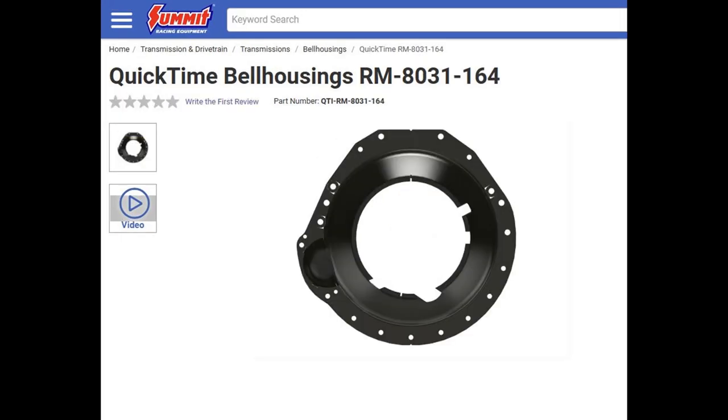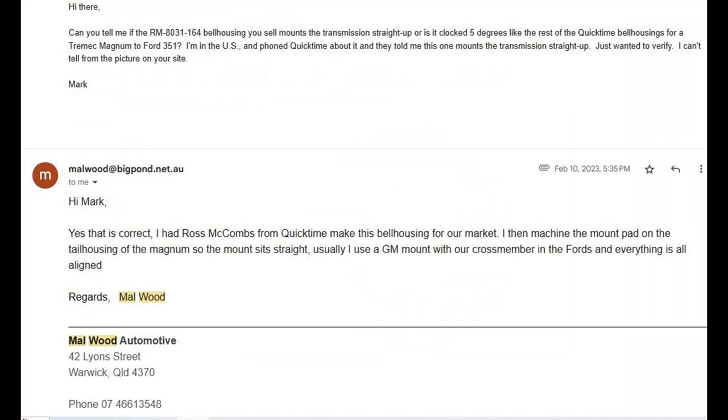RM8031-164. I did a little more research into this RM8031-164 bell housing. I found it listed on the website of an Australian company called Malwood Automotive. I got in contact with the owner, whose name is Mal. You can see the email exchange between myself and Mal, where he indicates that this bell housing was made by QuickTime in order to mount a Tremec Magnum behind a small block Ford in the straight up position. One thing to note